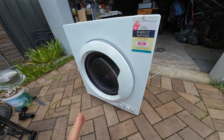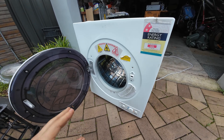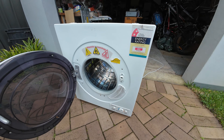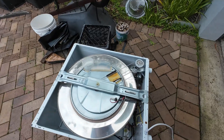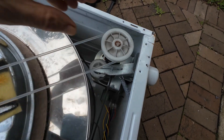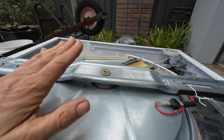When I replaced the fan belt, I could see that it was starting - it was trying to start, but it just wouldn't start. I'll show you what I mean by that and we'll start to do some diagnosis on start capacitor failures - when you have to replace them and how they test when they're not working properly. This is the replacement fan belt, 270mm diameter, any generic 270mm belt will do. As the motor turns, it goes into a ring gear or ring pulley on the shaft and that turns the fan.